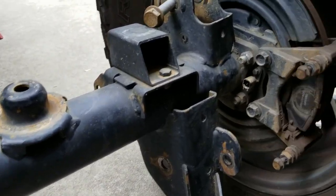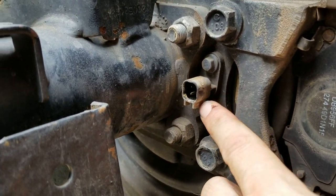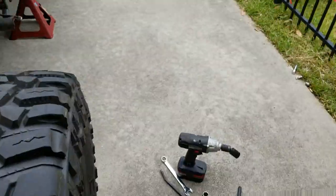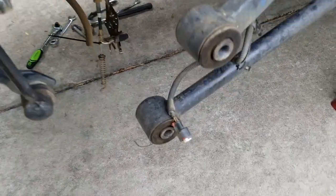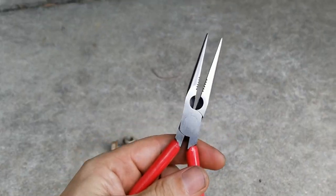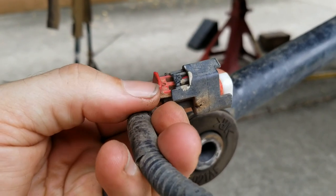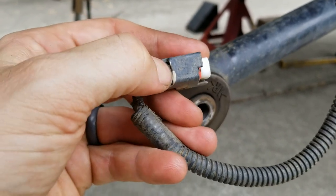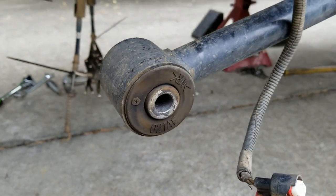Some people will tell you with ABS sensors it's mostly better just to unbolt them and pull them out, because you might break a connector. But it's really not difficult. All you really need is a pair of needle nose like this. That red tab on the connector would be pushed in all the way, flush with this edge. So you just get the needle nose on here, slide it back, press this black clip, push in and out, pull back, and it should pop loose. Not a big deal.